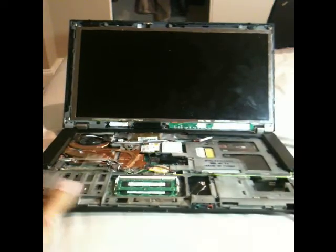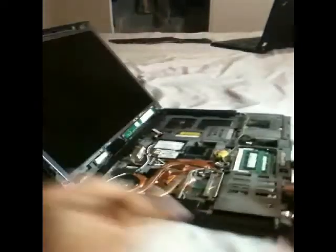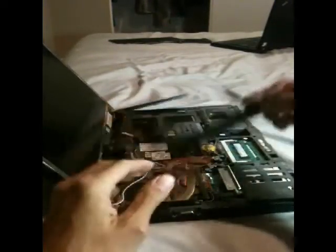The keyboard liner is easy. At the right bottom edge, just push down, push out, then lift straight up. It has to be straight up. Then to the left bottom edge, push down, push out, then lift straight up. That's it.